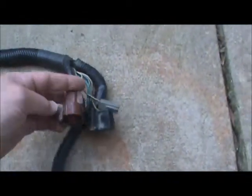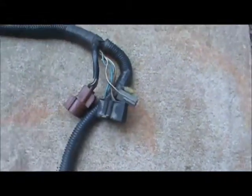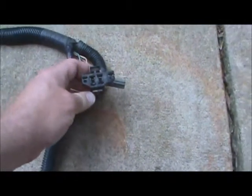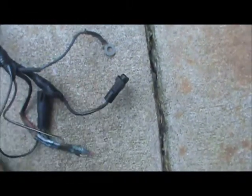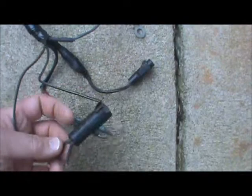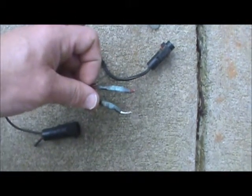Over here in this corner, because of the plugs right there, there's a single 8-pin connector here — it's brown. From what I understand, this is the test port for 92 only, to plug your diagnostic tool into. Coming back here, there's a wire that goes to the battery feed, a ground to the body, this is part of the A/C cutout switch, and these two wires actually feed into my MSD 6AL box.